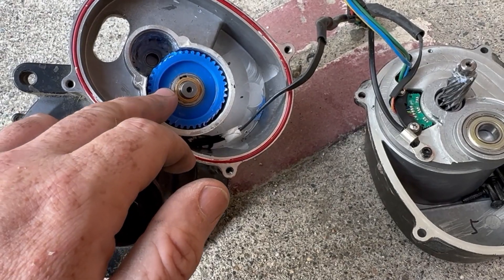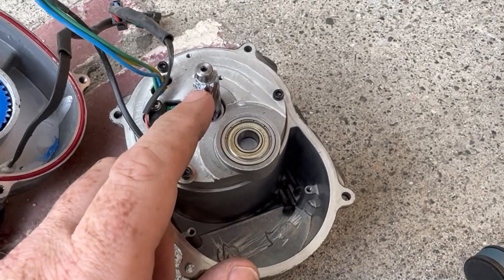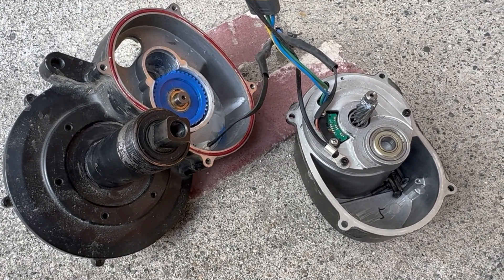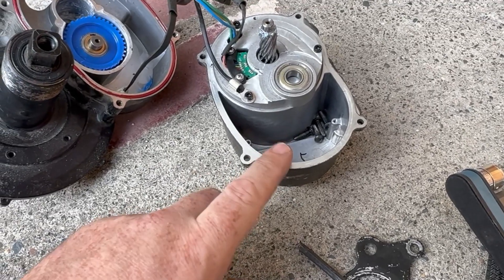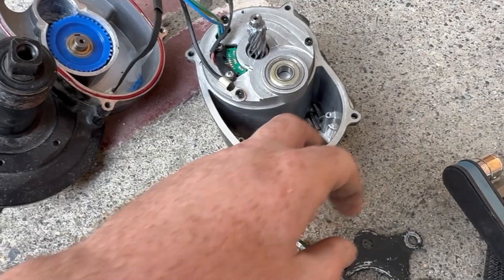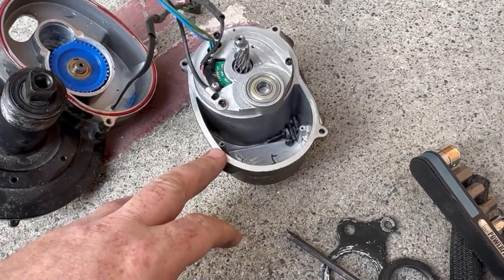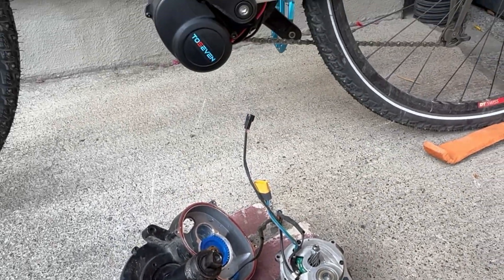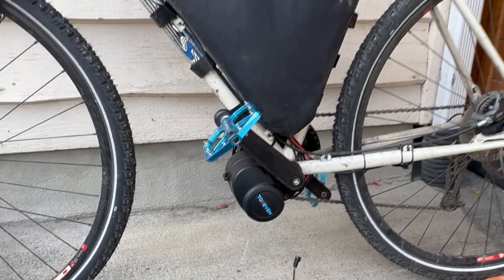If there's a way to get those teeth done differently, we'd have to rethink this part as well. But if this gear could be beefed up while keeping the same reduction ratio, it'd do a lot better under high power. Also, removing the controller from here is a huge help, since the controller doesn't duct heat out very well. There are some people now doing modifications for better heat transfer on the controller — I want to see how the stock setup goes before I mess with it again. I'm looking forward to sharing that in a video. I know I've been slow at putting videos up recently, but it is what it is. See you soon!